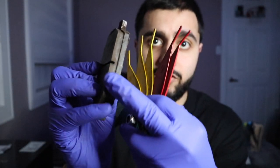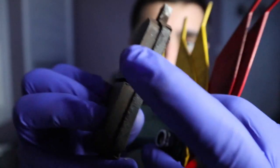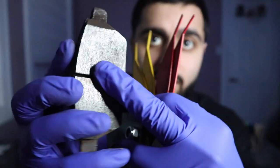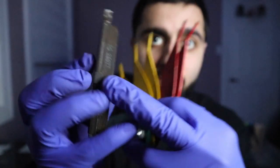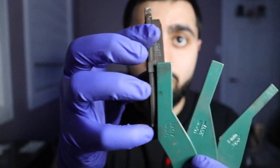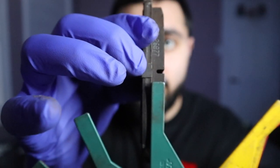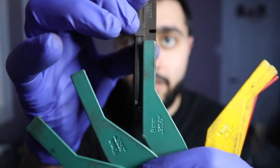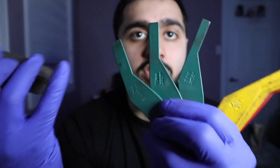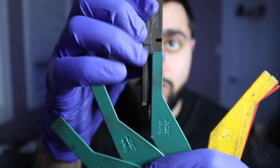All you're going to do is very simple. This is your brake pad — you're measuring the brake pad material, not the backing plate. You just line these tabs up with the material of the brake pad. This one's too big, this one's a little big, and you see just like that it lines up with eight millimeters — that is in the green, which means it's good. That's how you measure it with a brake pad gauge.